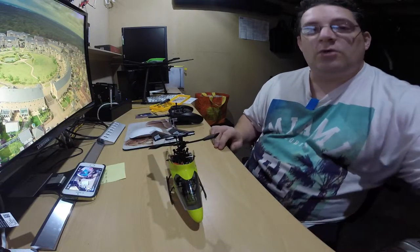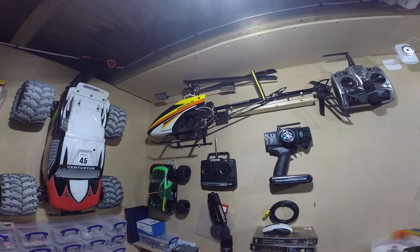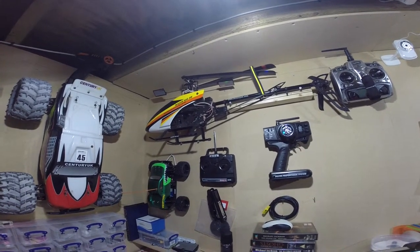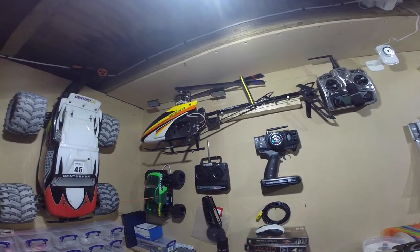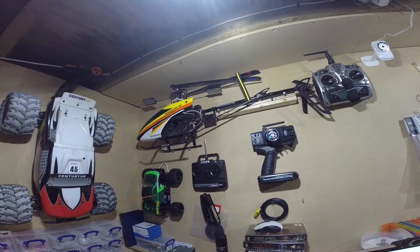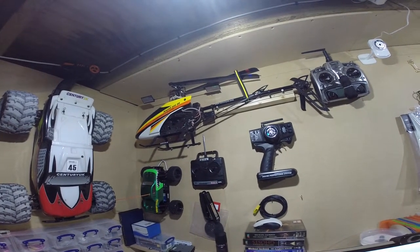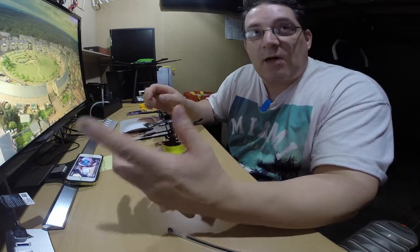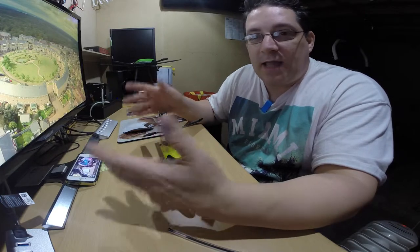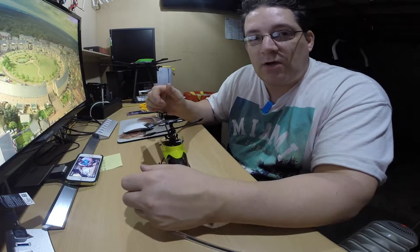I've got another build to do, which is this beast up here — the T-Rex 500. I've broken some of the cogs and the main cog itself is broken as well, and obviously the blades at the top have gone too. But I'm actually going to fit it with a GPS gyro so it should fly itself — a return home feature. We'll do a build repairing it and upgrading it to GPS using the DJI Naza flight controller. If I fly it off and want it to return, I can use the return home feature and it will come back and self-land.